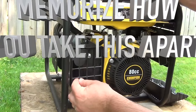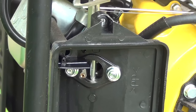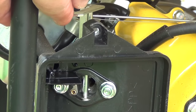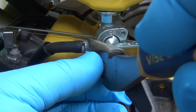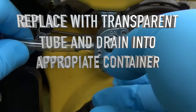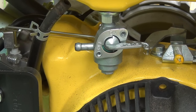While we take this apart, we memorize how we take it apart so we can put it back together in the right spot and in the right order. Let's check if the choke works — when you pull the choke lever, the little door here has to close, and that seems to work pretty well. We take the gas line off to see if the gas valve lets gas through it. I replace the black line with a transparent line so I can see if gas is flowing through it. On the other end I have another gas tank to drain the gas to, to check if the valve opens and closes. In this case it really does work and gas is going through the line.